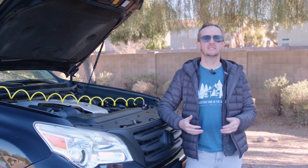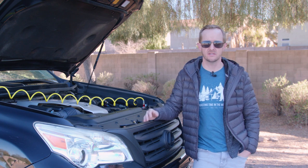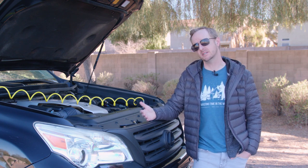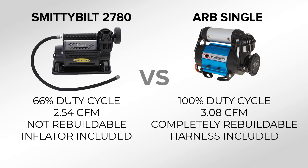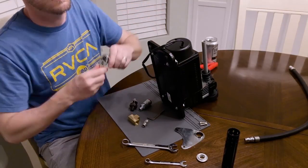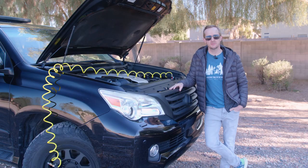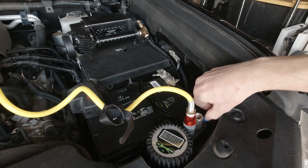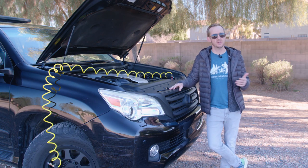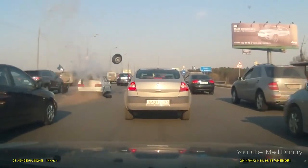My system is based around a Smittybilt 2780 air compressor. It's not a compressor you normally find mounted under the hood, but it's about two thirds of the performance of an ARB single for about a third of the cost. In a previous video I covered the comparison between the ARB and the Smittybilt in detail, as well as how I tapped into the Smittybilt's wiring to add a pressure switch and make it more comparable. Adding a pressure switch allows you to shut the compressor on and off by stopping the airflow — you'll need to do that to make this project work. If you don't add a pressure switch and you let your compressor run with the airflow closed, well, something like this might happen.